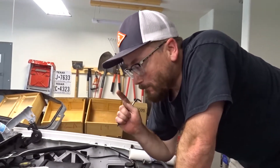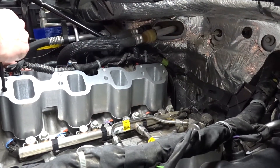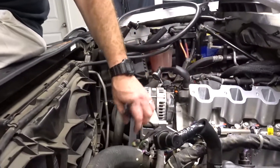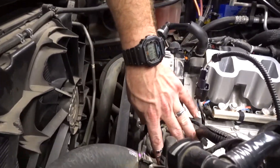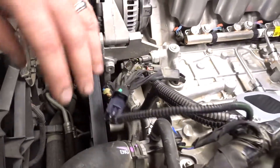When you're tightening these, be very careful — you can easily strip out the threads in your aluminum head. Now that this part's done, we have to hook up our coolant temperature sensor relocation kit. The kit comes with a wiring harness, which I've already run down there — you can see it right here. I've got it plugged in already. This is your original harness for the coolant temperature sensor.